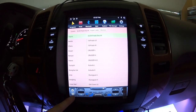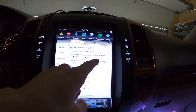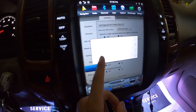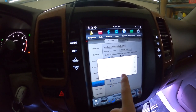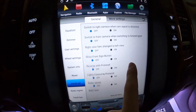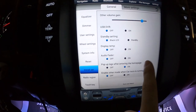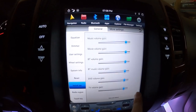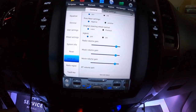Next, we're going to go over the backup camera and the reverse video format. If your backup camera is not working, just mess around with these four different options. I know some people have been saying the YUV signal has worked the best for them — so if CVBS does not work, use the YUV 720p signal, which has worked for a good number of people. I have left everything on off for the most part until we get to the pop-up logo after entering the homepage, which I leave on so I can see the GX logo. You can also control the volume here.